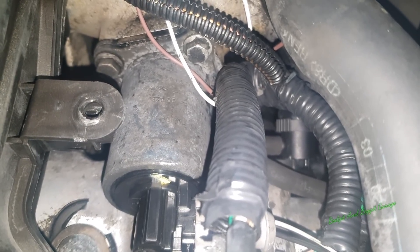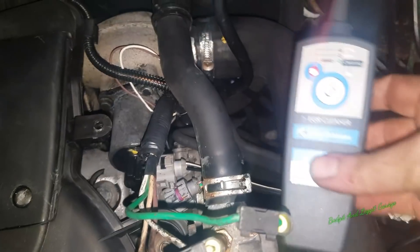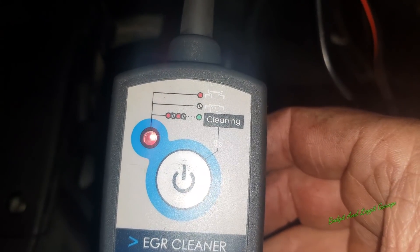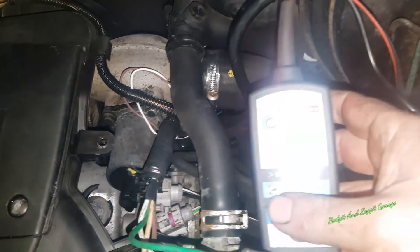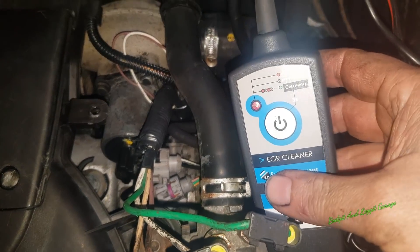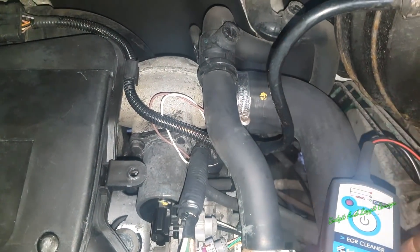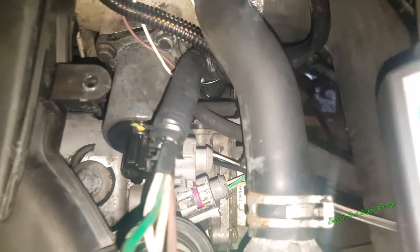That should be clicking — you'd really hear it going clunk, clunk, clunk. The machine is still sending power to it as you can see, still flashing, but it's not doing anything. What this machine is actually doing now is technically cleaning it by actuating it in and out, so if there's any loose crap it will remove it. But this EGR valve is just completely and utterly blocked.